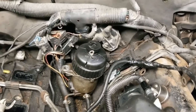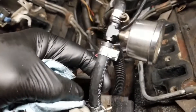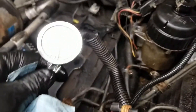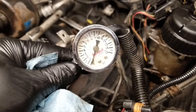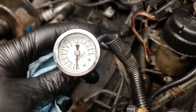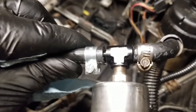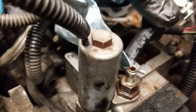I was checking the fuel pressure. This is your inlet pipe to the injection pump from the filter. The line runs up underneath and I have it run into this — a 15 PSI fuel pressure gauge for carburetor, gasoline, whatever. I T'd it in. I'm going to read the fuel pressure at the injection pump when cranking and running.